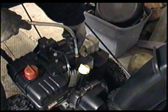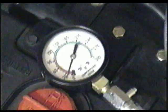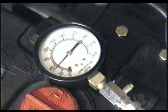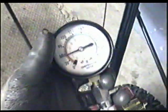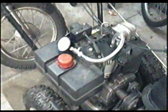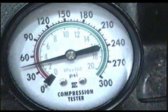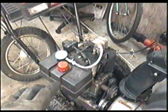Let's get our tester in there. The best reading I'm getting on this engine is almost 60 pounds, and there's no way this engine only has 60 pounds of compression. Here's an older machine I did a compression test on — on this one I'm getting only 50 pounds, so it's a bit older, it's got more wear and tear on it. Now I can compare that reading with that of the new machine we just tested.